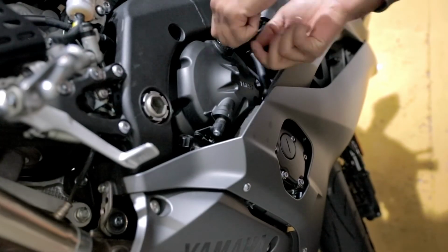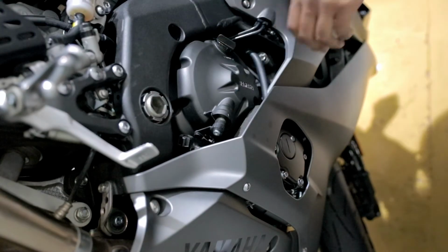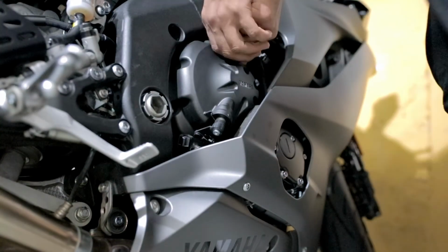And then removing the oil fill plug, grab this with your hands and literally twist. If you have enough might, just twist it and it twists right off. Put on your new Driven Racing plug, lubricate it a little bit, same 10 millimeter T-handle, and tighten it down, and boom. That's it, you're done. Take a step back, enjoy the new beauty and the accents on your bike, and just think, I paid less than $100 for these things.